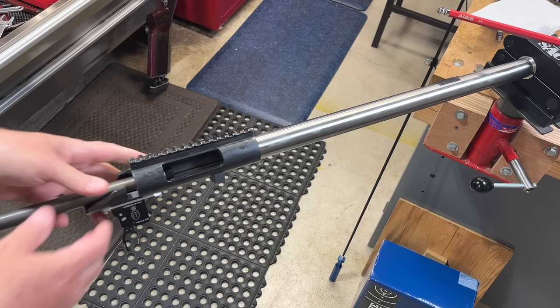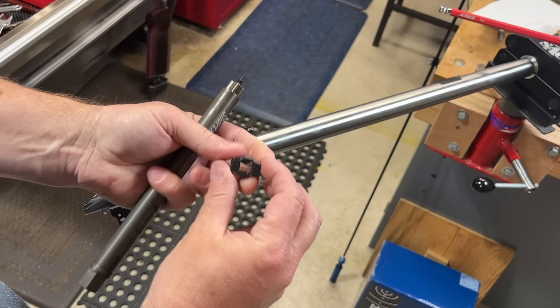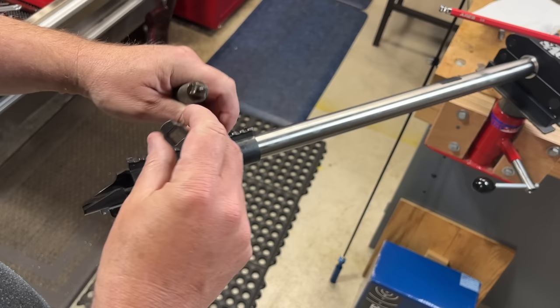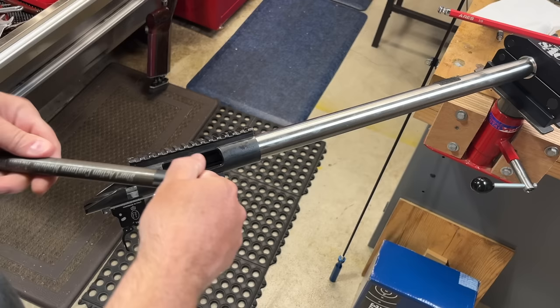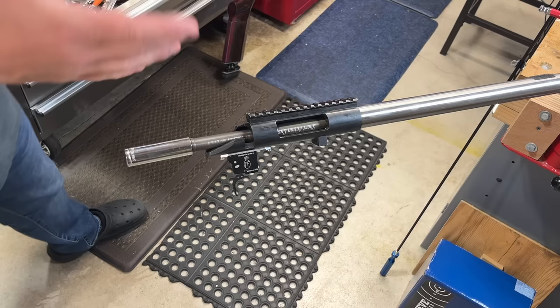Because you are putting this head on, you're probably thinking maybe it can't handle the torque. But it's nice — it's not just square-sided. What they did is, because if you had a square-sided one, you would potentially over time strip it out, it would round out. So what they've done is they've put these little recesses in each corner, which really give it a lock mechanism that isn't going to strip or round out. So we're going to go ahead and throw that in, and I'm going to go ahead and put this on here, and then I use a breaker bar just to get the action loose.